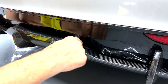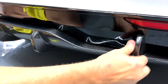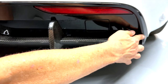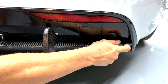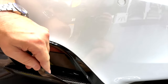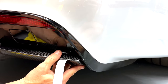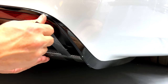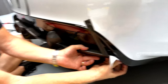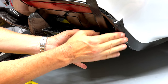That makes it really simple — it's completely flush all the way back. These two vertical pieces are just grabbing, and we just have to keep the corners down. Now we're going to get some tape, tape both ends down, and go underneath to put the screws in. We want to put some tape down below and hold it in place. Remember, this end can be sticking in or out, so you want it nice and flush. Pull the tape up and stretch it so it applies pressure. There's one, and another one here — tape below, pull tape up — so we have pressure holding it in this spot while the alcohol dries out.